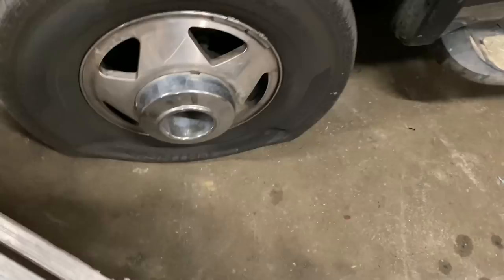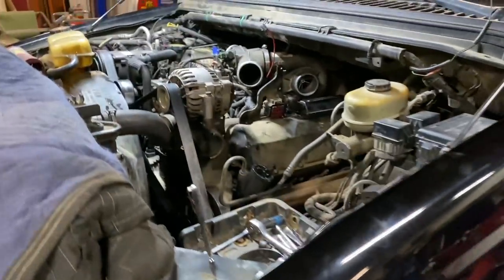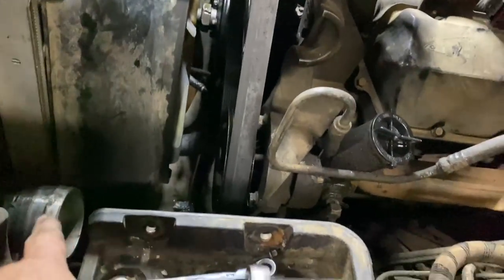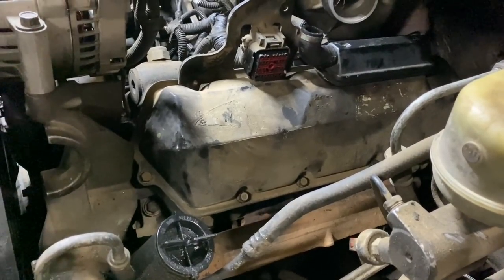The first thing you do - and this is not my idea, but this makes a huge difference - you let the air out of the front tire so the thing comes down. We got some stools and stuff, but that really does make a huge difference. Of course you take all your air box off, take the battery out, get it so you can access it, take this pipe off. It's very easy to do this side, but it's just very time consuming.